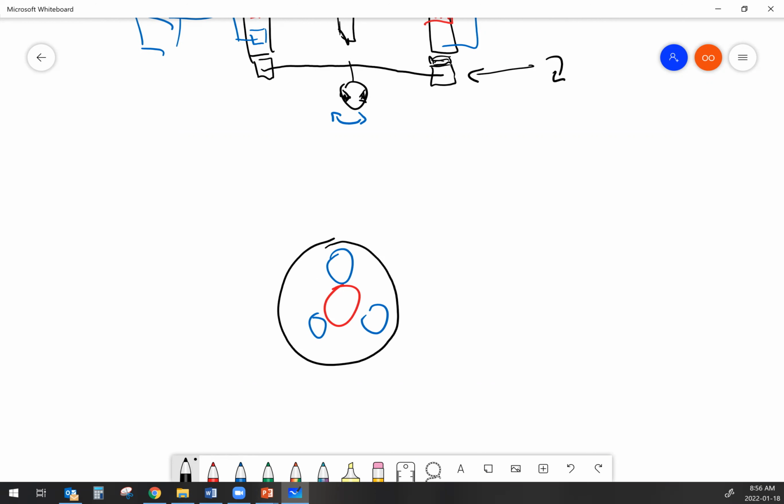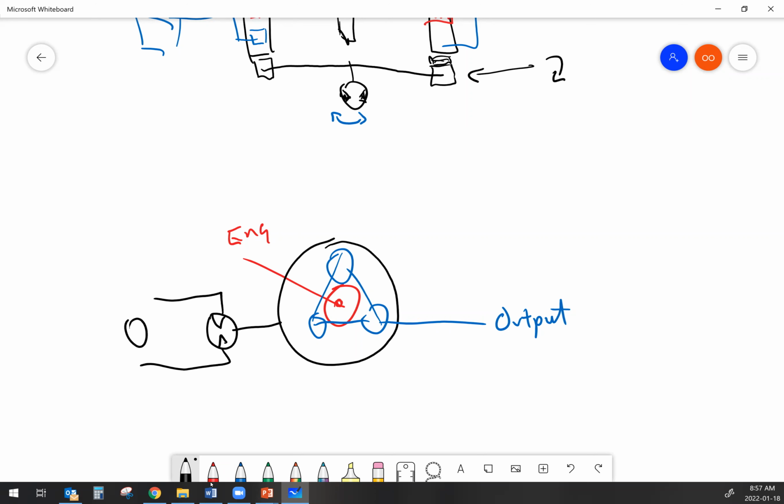and I have this thing hooked up so that maybe my engine is going to power the sun gear, right? And perhaps I've got the transmission being driven off of the carrier. And then I go ahead and I hook the ring gear up to a hydrostat drive, like so. And now what I can do is use that hydrostat to hold that ring gear stationary. I can use that hydrostat to speed up, in terms of co-rotating or counter-rotating, that ring gear, right?